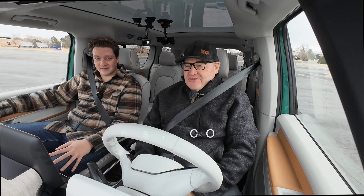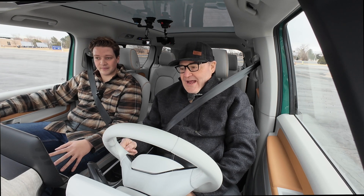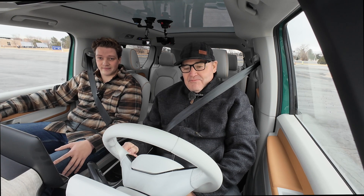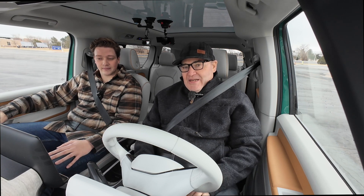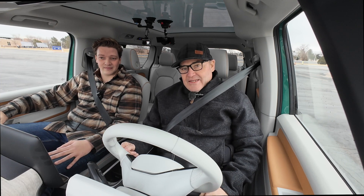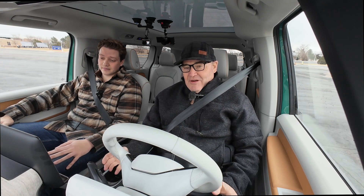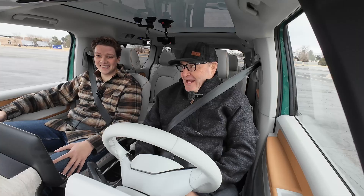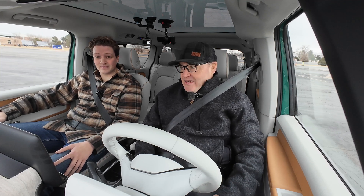Alex and I are by ourselves in the ID Buzz, and right now we've got 50 miles of range left and 23% battery. Lately I've been doing more time in Hyundai world — in Hyundai world this would be a problem, because I can't precondition the battery once it's below 20%. It won't let me because it's afraid I'm going to run out of charge. For beginners, that's not a bad thing — a lot of users coming to Hyundais are on their first EV and have no idea what they're doing.